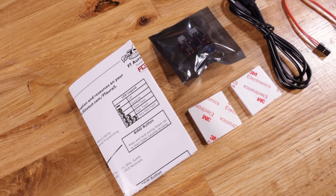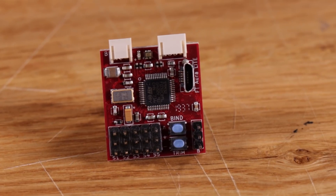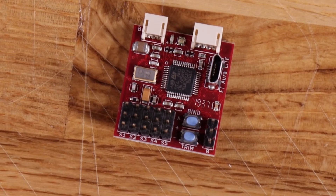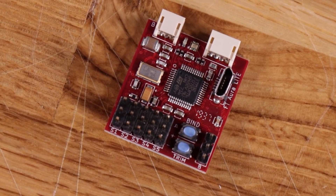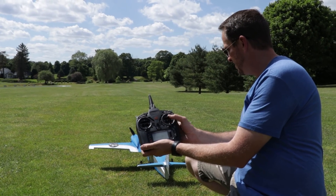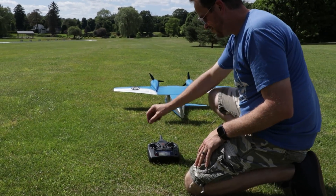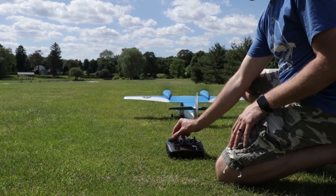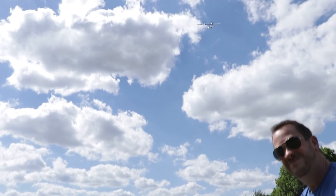Now, if you're new to flying, we strongly recommend putting in the Aura board. We're going to have a special tune that you can download that's going to give you differential thrust, which will mean you can move one motor forward and backward to be able to steer easier on the water, but you're also going to get the benefit of differential stabilization. Along with that, our Aura board also provides something called launch assist, which helps you take off the ground very easily. Whether you're in the water or on land, when you put it in launch assist mode, the plane is going to track perfectly straight and true and climb out at an angle of about 30 degrees until you move the sticks on your aileron or elevator.